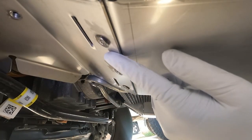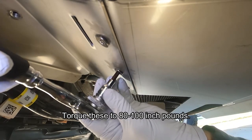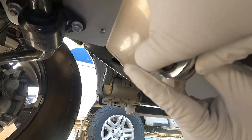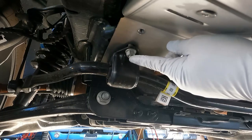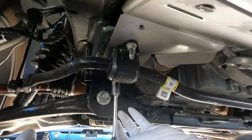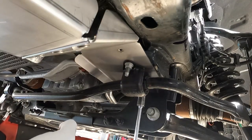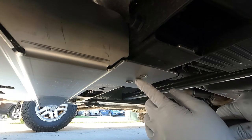Now the tightening sequence begins. Fully tighten these six screws that connect the front shield to the main shield — three on either side — torquing to 80 to 100 inch-pounds. Then tighten the three on the other side. Now re-tighten the nuts that hold the sway bar bracket on. I'm using the battery-powered Milwaukee to get these snug first, then torquing to 46 foot-pounds. Same with the passenger side. Now fully tighten the rear part of the shield with the M8 fasteners, again torquing to 80 to 100 inch-pounds.